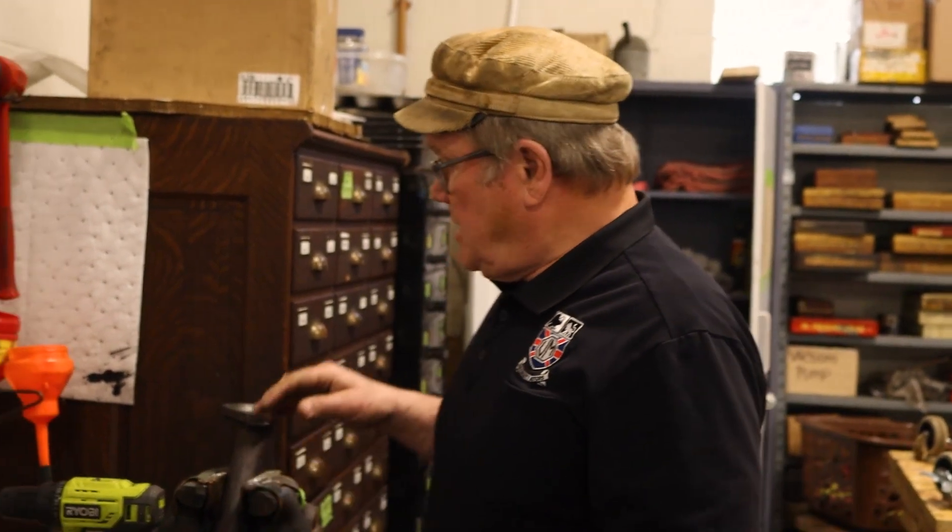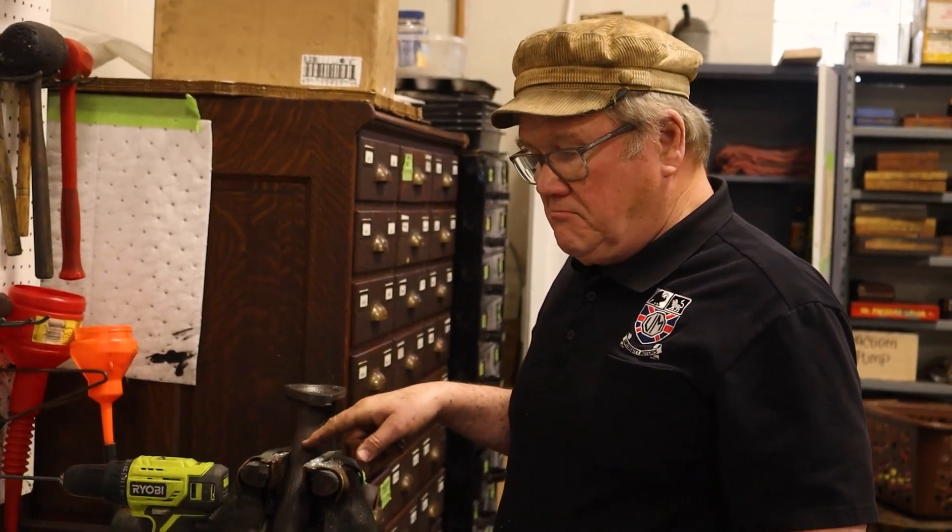Anyway, that's how I repair an exhaust manifold. Once that's done, you can either sandblast it and put some kind of high-temp paint on it, which only lasts for a short time, or you can send it off and get it jet-hot coated. That is so slick, and then it's just beautiful from then on.